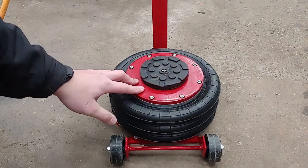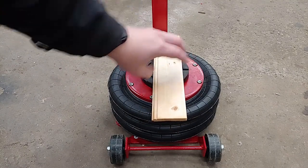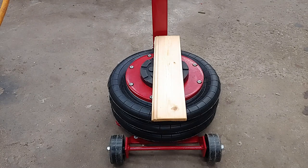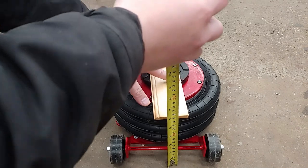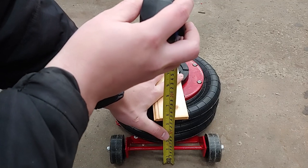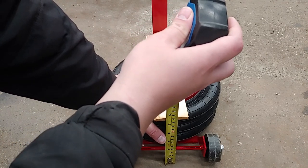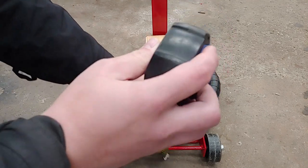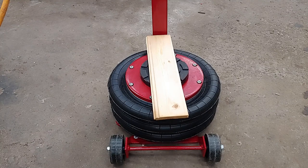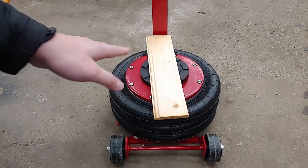Other than that, the top plate is really heavy-duty looking and I don't see any other faults. So I'll measure the minimum height here. We're measuring about to the bottom of this piece of wood — it's not perfect but it gives you an idea. That's 5 and a quarter inches, or 132 millimeters. So that's not bad — actually lower than the spec which calls for a minimum height of 150mm or 5.9 inches. This will actually go under vehicles lower than it states.